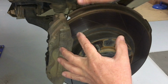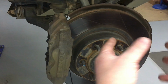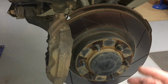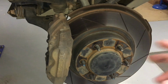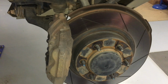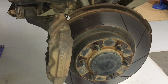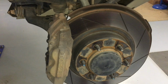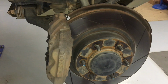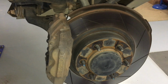That's this assembly here. See this here, the whole bit of steel that the bearing goes into. Just lift it up out of the way and spin it around so you can get to the back, and that's where you're going to get that extra seal out and replace it. There's no point doing the bearing if you're not doing the seal, because the seal could have been the cause. When we get these old ones back, for anyone that's local that does bring them back, we don't need them back or anything, but if you do, we strip them down, have a look and analyse a little bit to find out where the water or whatever's getting in, see if the bearing's dry, whatever the case may be. And we've seen some crazy stuff with some cheap bearings. That's why I say don't bother with that, just stick with the genuine stuff.